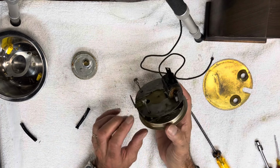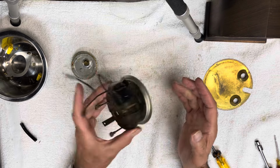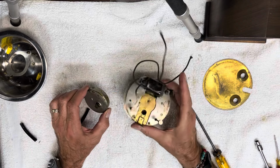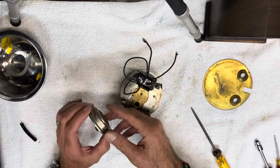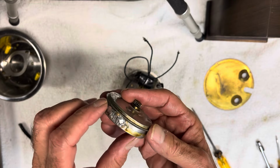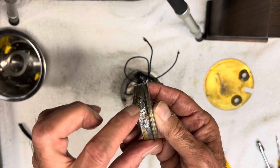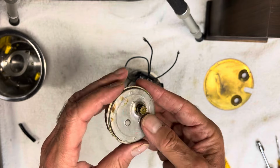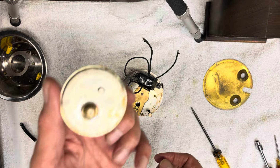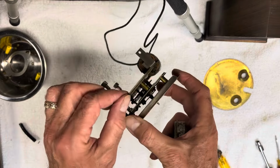I'm going to take a closer look to see if there's any other way to access the gears other than trying to go sideways to undo the nuts over here. So give me some time to work on that. Okay, another thing I'm noticing, I believe this may have been serviced in the past. For sure, it got a new power cord attached, but the solder job around this rotor is such a sloppy, messy job that I think someone opened it up to try to re-lubricate it at some point. When you see one of these for the first time, it's just a small little dollop of solder, very neatly done. So I'm thinking, let me try to open this up, clean it out, re-lubricate it, and just reseat it and see if this is where all the noise is coming from before I look to open this up, as it looks like it's going to give me a hard time to do it from sideways.